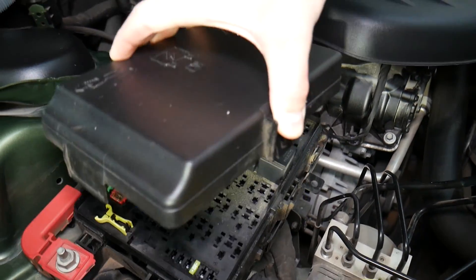There is one more fuse related to the power steering — it covers the engine controller and power steering. That is fuse number F37, the third one from right to left on that row. That fuse needs to be checked as well.